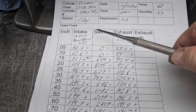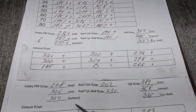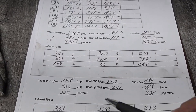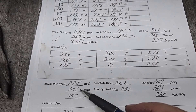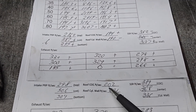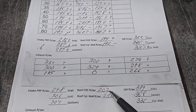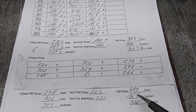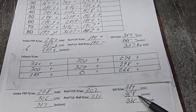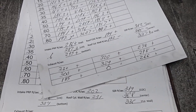Top page is the 1.85 — we're going to be comparing these air speeds to these air speeds. I'm not going to put pluses and minuses on it because it's just a little too confusing. Up, up, up — we're moving more air, pinch is going to get faster, makes sense. The bigger valve and the bowl blend make the roof come alive. We got a wider discrepancy between both sides. Short side: up, up, just a little down a tiny bit. All of them are moving more air — makes sense.